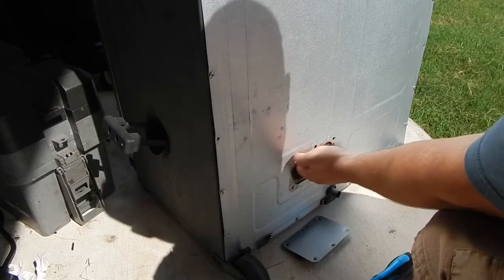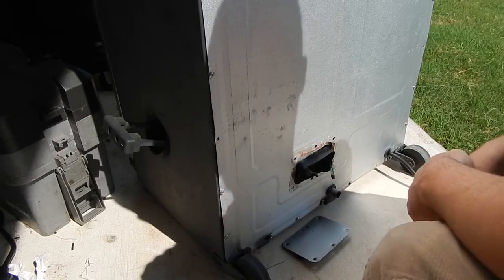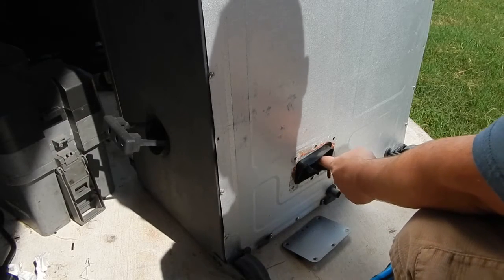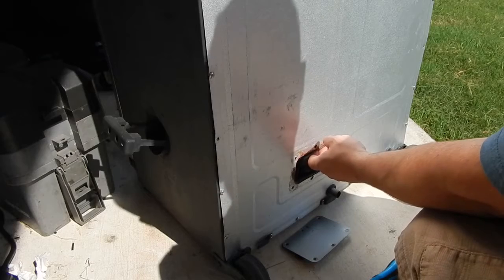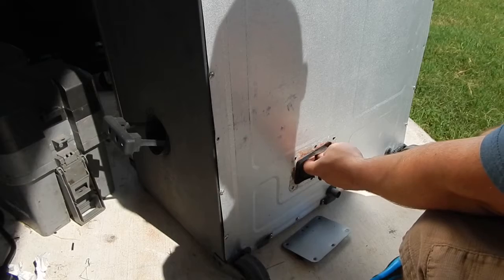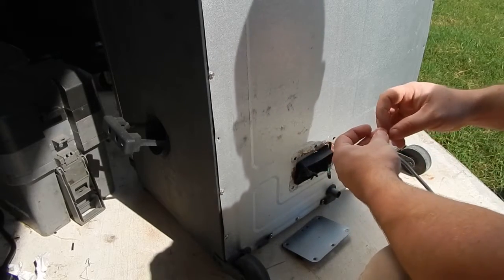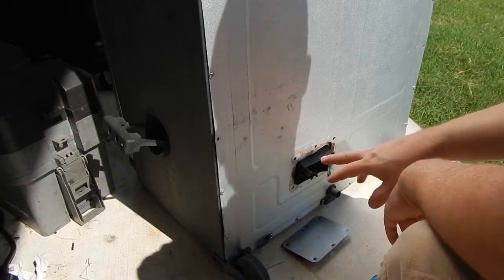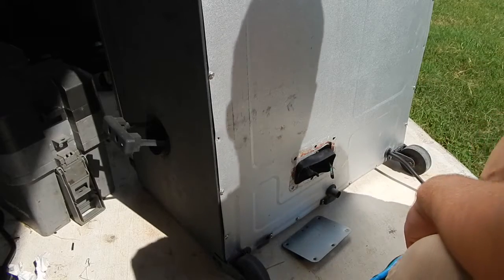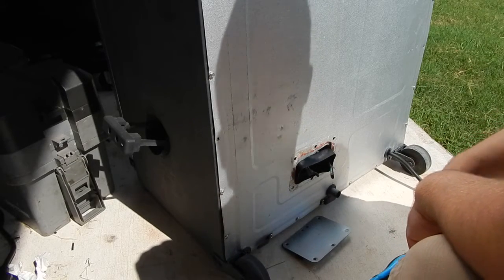The electrical box in here is totally loose because my heater element is out. It actually uses the bracket on the heater element to mount this box, along with six screws. Once you pull the heater element and the six screws out, the little metal box in here is loose. It probably shouldn't be, because it was foamed in place, but the foam tends to deteriorate around this box because it gets hot.